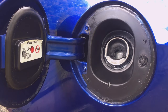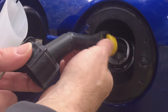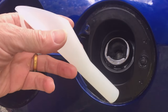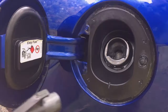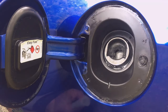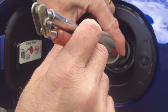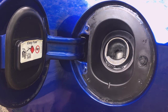Another thing I like to do is clean the filler neck itself. This system is designed so that a regular fuel can won't work — you have to go to the trunk and get the special funnel out of the spare tire area. This car doesn't have a spare tire; it has an inflator and a little air compressor back there. The funnel inserts into the hole and operates the two plungers on either side to open the fuel door. I can insert the funnel, push the door open, then use a tool inside to keep the door open, and take the funnel back out — the door stays open.